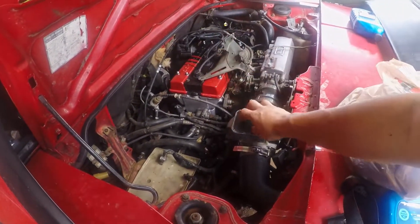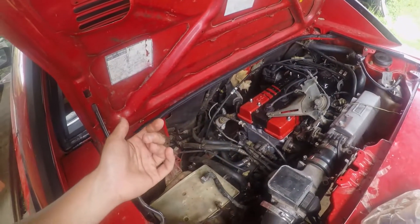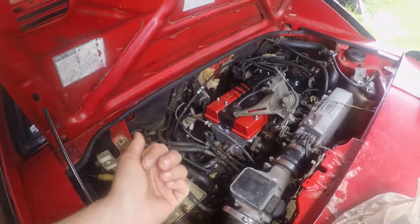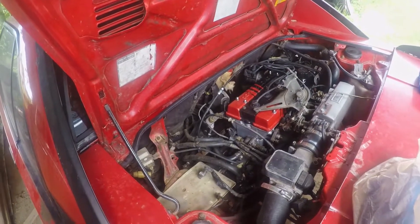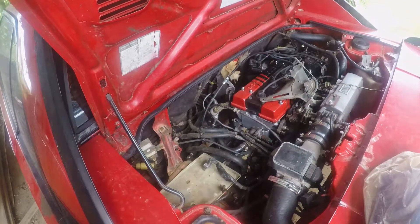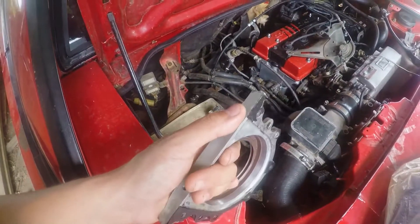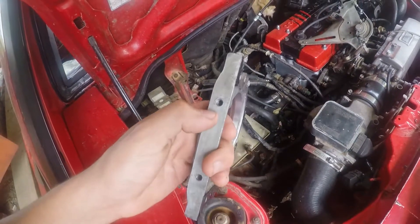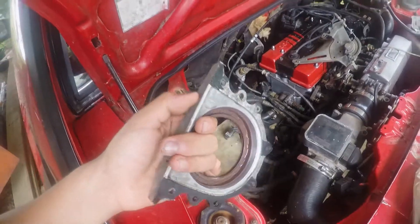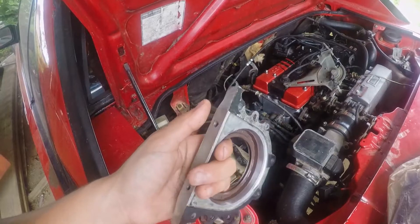It's been a while since I posted anything about the MR2. Last time we saw the first drive — it was a ripper, it was doing good — but it has a little issue: it's leaking oil pretty good on the oil pan, actually on the girdle. I'll insert a picture now. So you can see on the rear main housing it's broken in two locations. You're driving a steel bolt into an aluminum housing and it cracked.